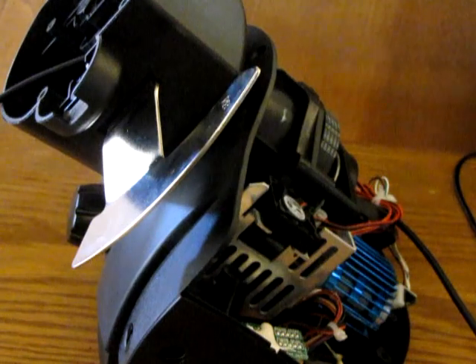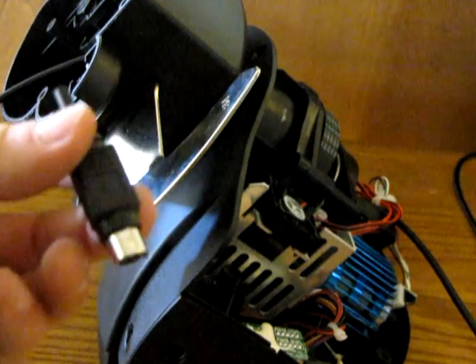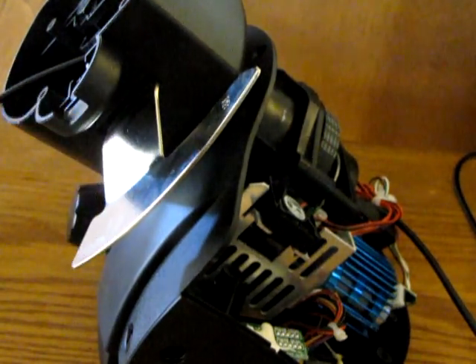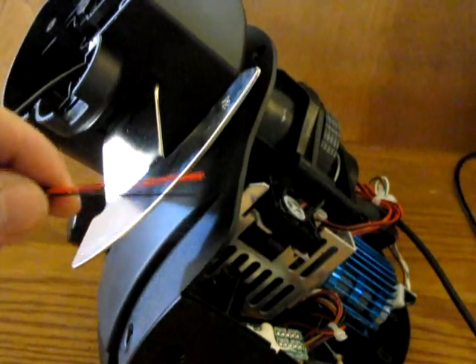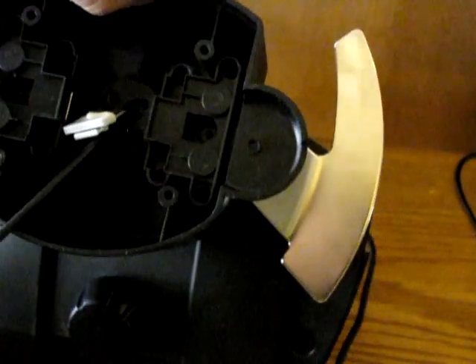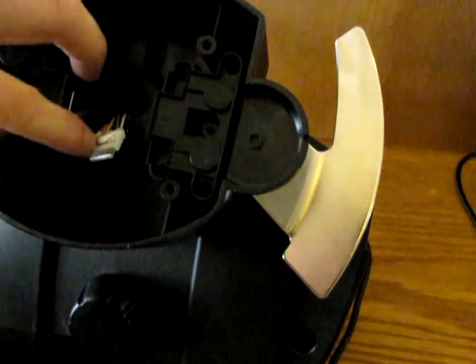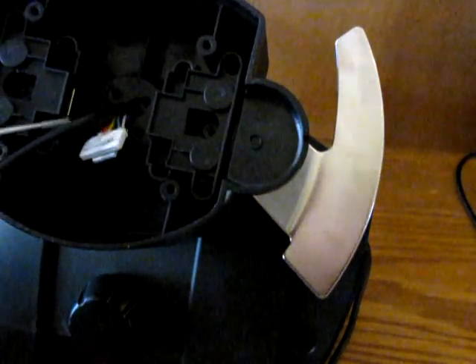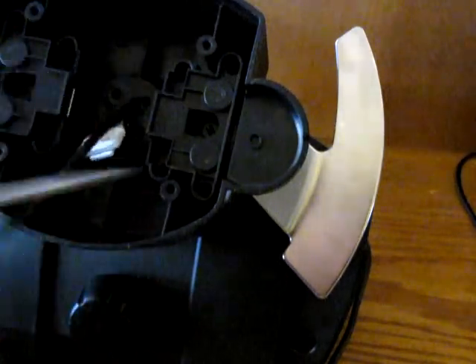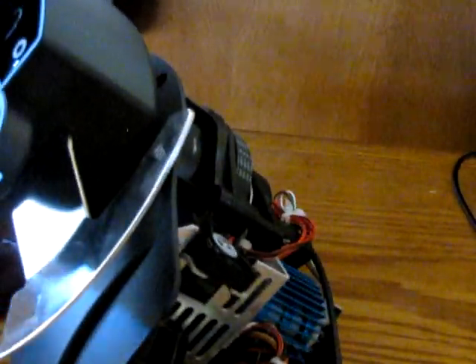This type of cable comes with the shifters — a PS2 cable. You can cut the end off on both ends; it's an extra cable you're not going to use, and you wire it up for the shifter. We used the red and black wires and ran the wire itself through the base. The plastic clear jacket protecting the wires — you can use a small screwdriver tip to press the plastic out of the way, guide the wire through the hole, and it comes out the other side. Pull the whole length out and keep it that length so you can cut off what you don't need later.